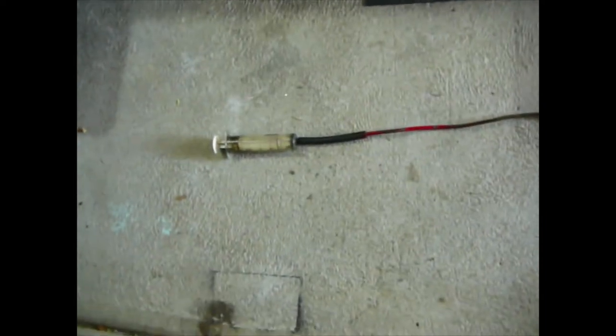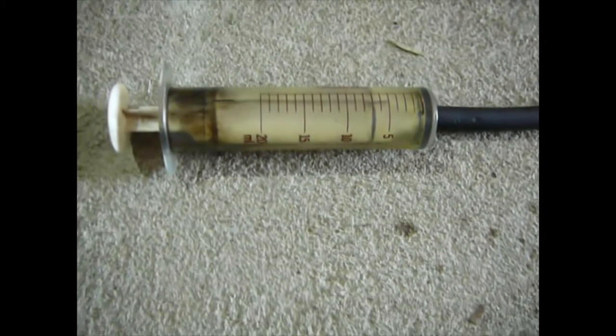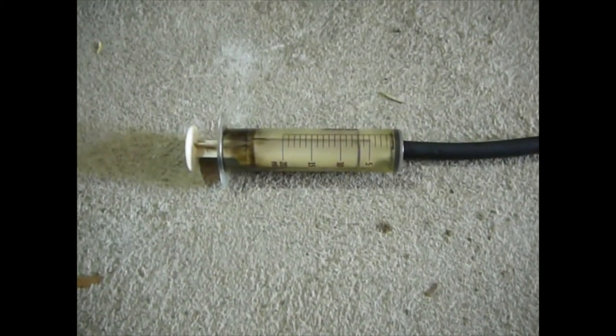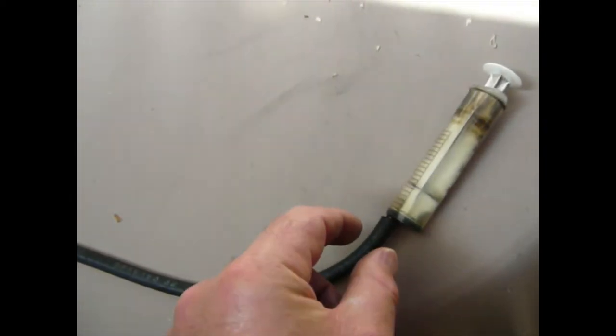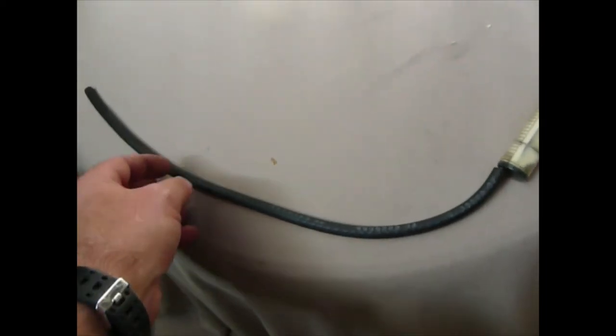You slowly but surely tweak little bits of it and find a sweet spot where it drops straight down to the bottom. This syringe is a 20 ml syringe, and when using two hands it's a rather quick method. I've already got between half a liter to a liter — 500 ml to a thousand ml — out of the front section, and I'm about to move on to the rear section. You just put a piece of flexible tube onto the syringe for the back section, as it allows you to flex accordingly, as opposed to the firm metal brake line used for the front section.